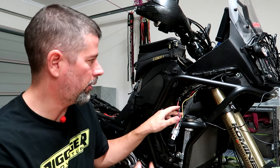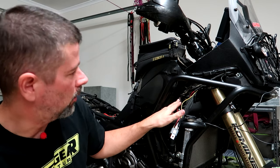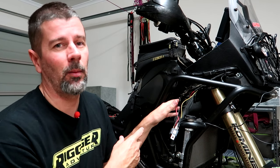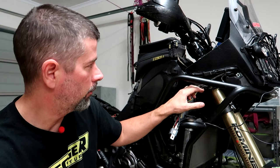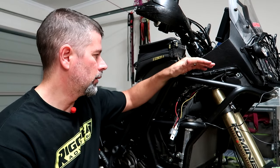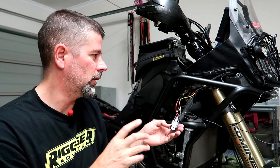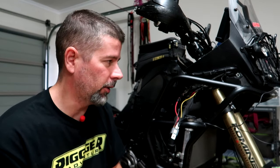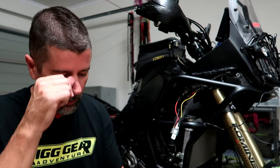I've wired into the plug for the heated grips accessory. As far as I know, that's what that plug is for — there's a three-wire plug behind your right-hand side fairing. I just cut the plug off and soldered my wires into that harness. As far as I know that's a 10-amp fused line for the heated grips. There's also a two-wire accessory power plug which I've already used for my USB charging ports — that one was only a two-amp fuse. Basically all you need to do is get your standard relay and wire it just a little bit differently to get this working. I'm not going to pretend I know how it works — all I know is that it does work.